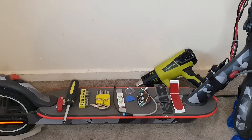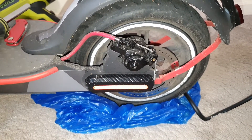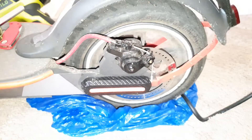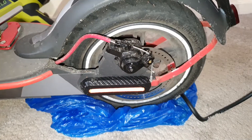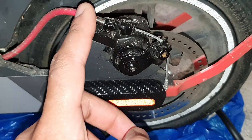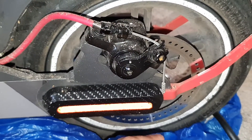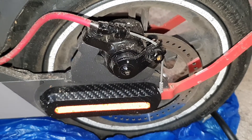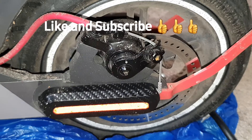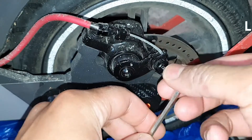So the first thing we need to do is release the hand brake cable. On the rear back where you see the cable, we need to loosen it here so that we can relieve some of this cable tension. As you can see there's a little Allen key slot just here - we just need to remove and loosen that up so we can get the actual cable slightly free. And now you can see the cable has gone loose.